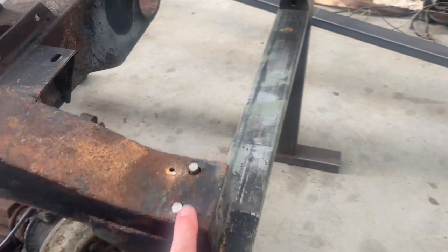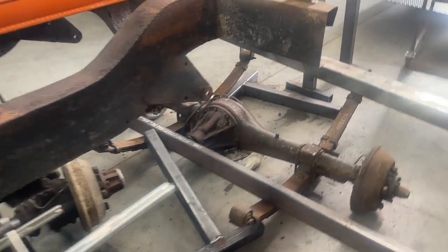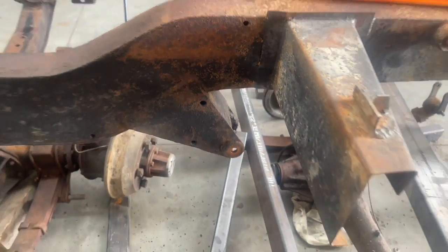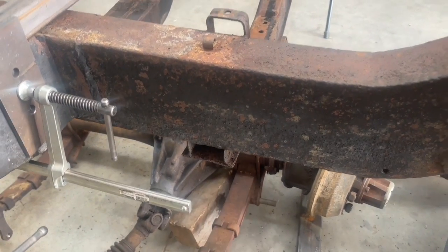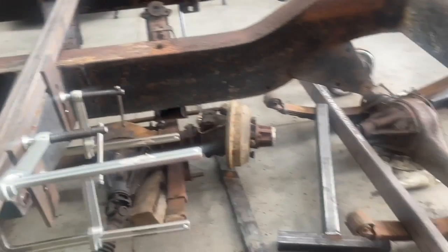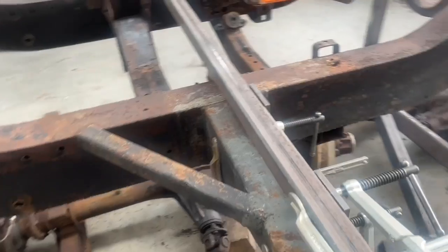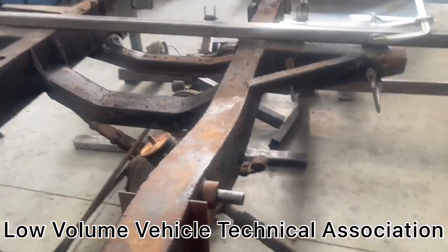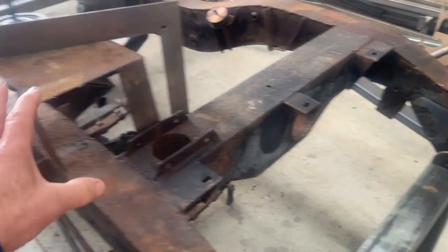There's been a few repairs in the front, but nothing major. My intention is to use this chassis as a basic layout and I'll build a jig around it. I'll use these pickup points for the springs as the primary locators. My plan is to use the military design for the crossmember under the gearbox so that it can be bolted in and bolted out, so we don't have that problem if you want to remove the gearbox. I'll also think about some extra gussets, because the LVVTA guys in New Zealand are more interested in adding more than you need, and I'm also thinking about some of the redundant bracketry on this car.